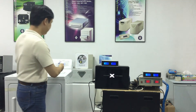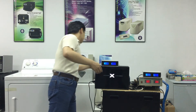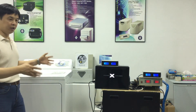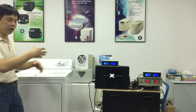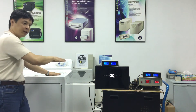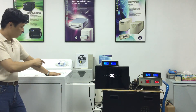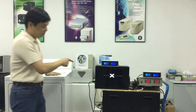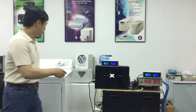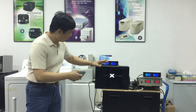Let's see how the dryer operates. Now the dryer's drum is making a rumbling type of noise and the entire dryer is vibrating abnormally. This is the result of running a 60 hertz appliance under a 50 hertz power source. The dryer drum rotates slower and consumes more current at the same time. This will fatally damage it over time. As the fractional motor in the dryer vibrates, the voltage from the transformer has been dropped to 116 volts.